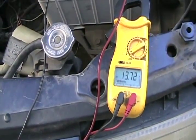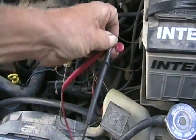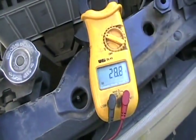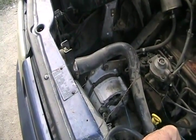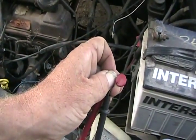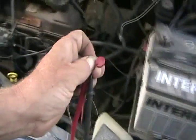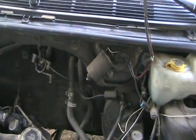I'm going to want to leave this in circuit when I'm using my vehicle. So now it's in circuit on that park wire which is on the wiper motor. Now it's warming up and the resistance changes. We'll turn the vehicle off and check. It's pretty hot, but the resistance did start off at like 48 ohms, and now as it's cooling, the resistance is becoming lower again. So that works out perfect for me. I don't have to put another alternator in. Every time I start the vehicle, I get the full 12 volt pulse to the alternator and it fires right up, then it immediately starts to heat up and the resistance gets up to 90 ohms. So now it's no longer shorting anything out, which won't damage the alternator, won't blow any fuses, and I can leave it connected to my park system for the wipers. Everything's back to normal.